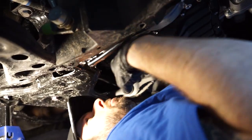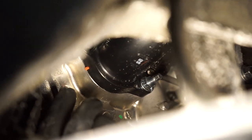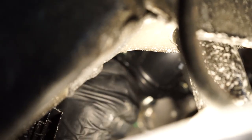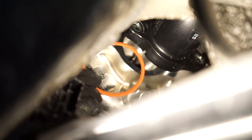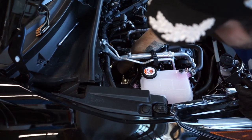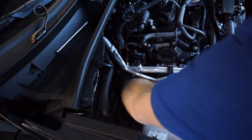There's the turbo right up there - what a beauty. So we're gonna take this bolt out, and then this side looks like a stud so there should be a nut that comes off that. And then this little orange rubber thing - that's the gasket we're gonna reuse. I'm gonna go ahead and get the tools for this, get it off, switch the gasket over, and from there we should be putting things on. And I believe this thing is free to go - with a resounding clunk. So I'm just gonna pull this gasket out now because I don't want it to catch on something as I lift this entire intake tube out.